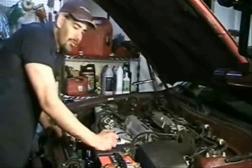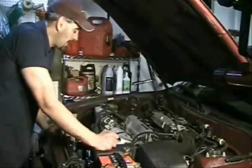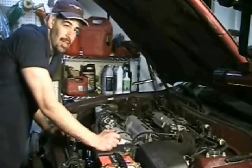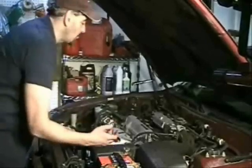By this time the car should be pretty sufficiently warmed up, and again you want to keep an eye on that temperature gauge. If the car didn't warm up at all and never brought heat, you probably have a thermostat problem — a real easy fix, but something you might be able to use to negotiate a better price.